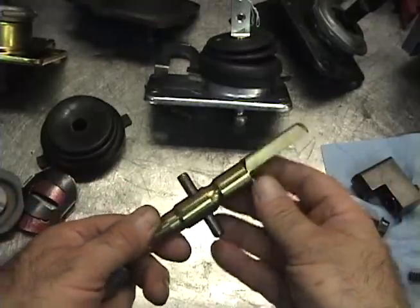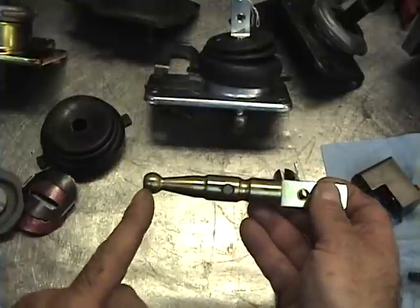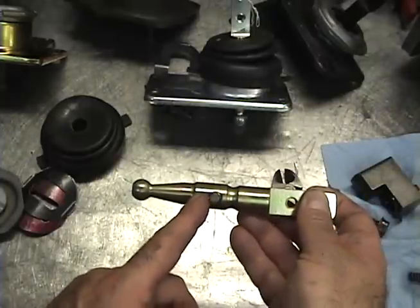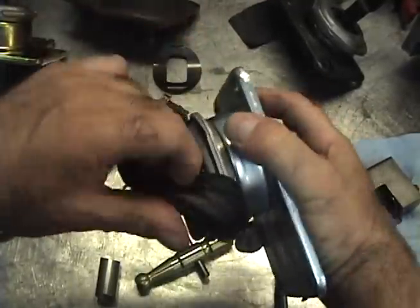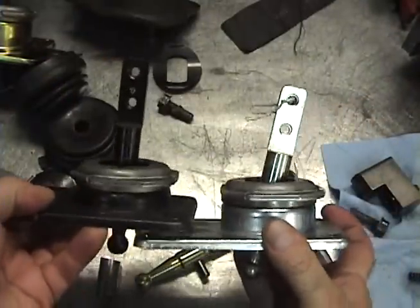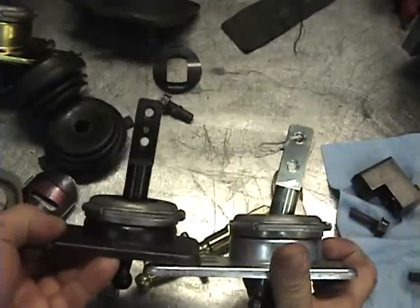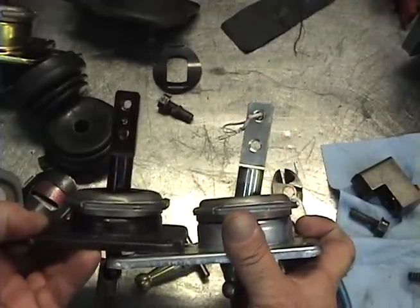This is your shifter shaft. Shifter shafts on these 5-speed shifters have different lengths from the centerline of the ball socket to the centerline of the actual pivot pin. Units that have a lower centerline will shift with a lot longer throw than those with a higher centerline. A good example is these Ford shifters — the Ford Motorsport transmission on the right compared to the one on the left. This is their standard Ford T5 shifter, which is a longer throw shifter. You can interchange them, but all they do to make a short or long throw T5 shifter is simply raise or lower the pivot point of the stick.